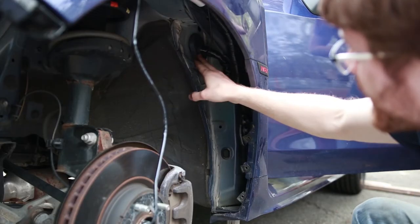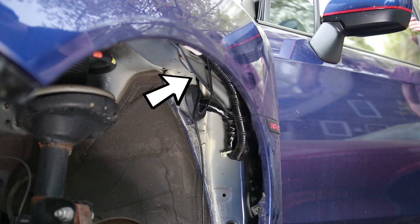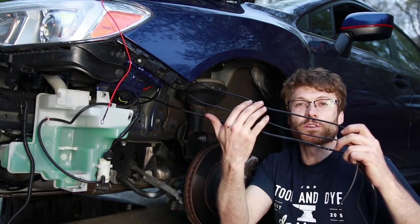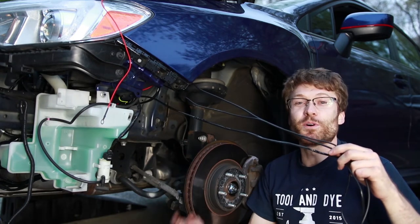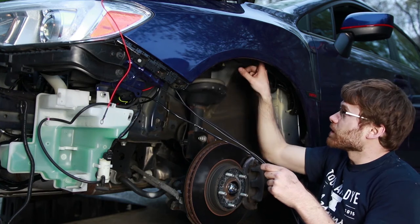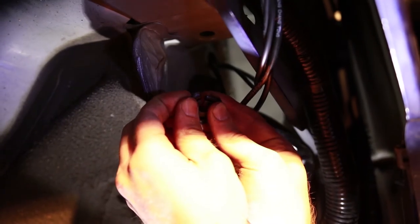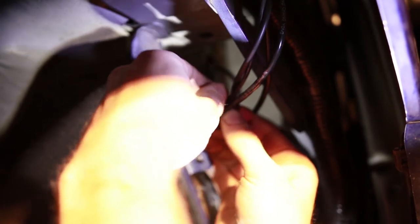Here's the main wiring harness that goes into your cabin. This is your hood release wire — about an inch above that is a grommet. You can push that in and it'll fall inside the cabin, and that is where we're going to feed all the wires through. Run your wires into the cabin along the wire loom right along the top — there are hooks up there — and zip tie that, then go into the grommet. We drilled a hole in the center of the removed grommet and sliced it so we can slip it around our wires and then cover that hole again to keep water from getting inside the vehicle. Slide that up and pop it in place, and you can put a little silicone on there as well to ensure a good tight seal.